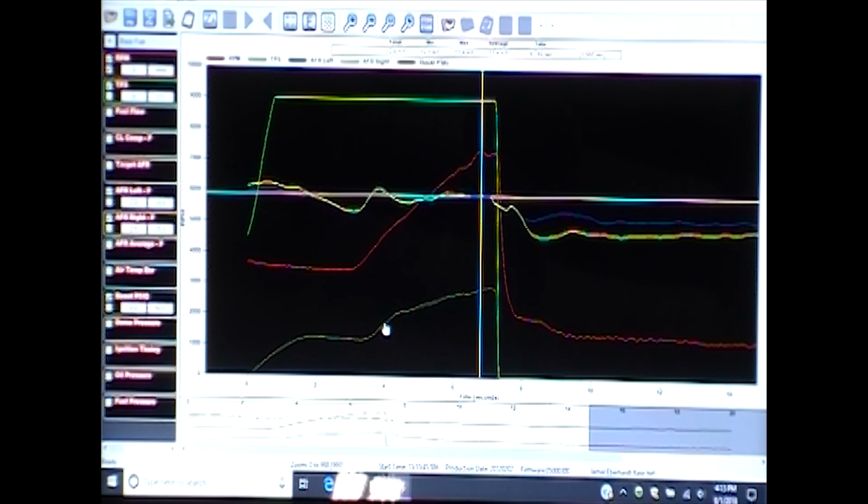So the Holley boost controller is really a pretty nice piece. 99% of the time I use it with dome pressure control. So we're always just controlling dome pressure and not really referencing it to the actual manifold pressure. Not a big deal. I don't care how you want to do it, but it takes a little more work to figure out how to get it to use the MAP sensor along with the dome pressure sensor. But anyways, as you can see, really nice piece.